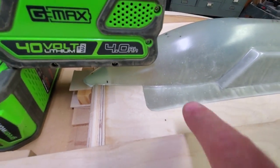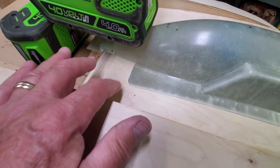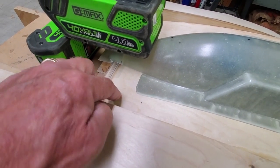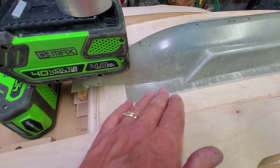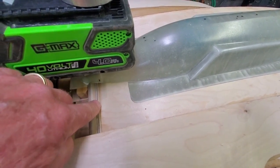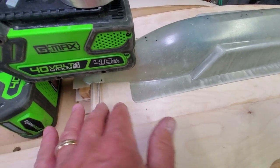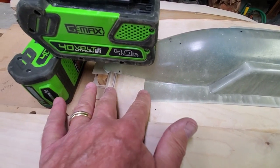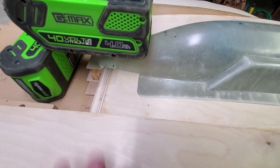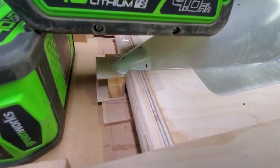The cowling does not come cut like this. You're going to build your own forward section. I'll show you more of this once the cowling is off and we talk a little bit more about how this is going to mount. When I lay up the cowlings, this flat area comes all the way forward to where the bullnose attaches to the deck here. As we talked about in an earlier video, we've extended this about 2 inches, and so all you need to do is cut this back. It's very, very simple. You will see, and I will show you more.